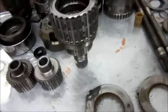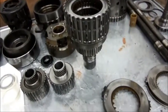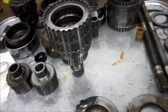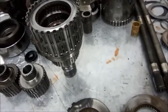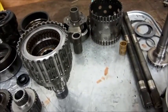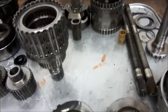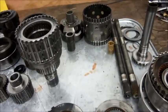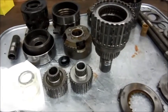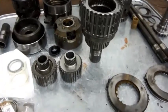I'm going to go over some of the durability and performance modifications I'm making to this transmission. This is a 1986 specification 440T4 transmission and I'm using some 4T65E parts to make it more durable. I'm going to use it with a turbocharged engine that would have quickly damaged the 440 — probably would have driven it for a day, 100 miles or so, and then it would have started to fail.